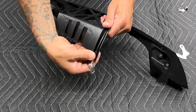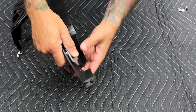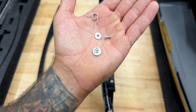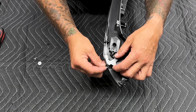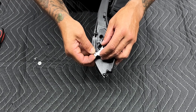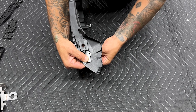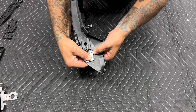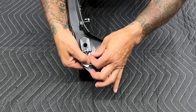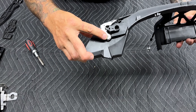You have these little grooves — they'll line up here to lock it into place. Now I have the locking cable ran through the channel, with this part towards the front. To assemble the locking cable, you have your spring, your washer, your M3 screw, and your barrel bolt. Take the spring — this longer end is going to go towards your locking cable. Insert it in here, and then the smaller end goes inside this hole. Take the barrel bolt and go in from the other side, pop that in, and line it up with this hole. Take your M3 screw with washer and put this in. We have our barrel bolt on the back, our small M3 screw with washer, and our spring.